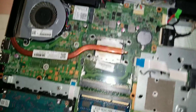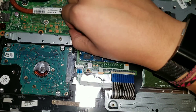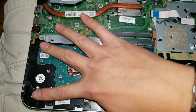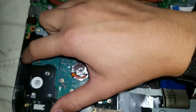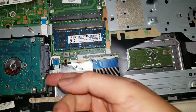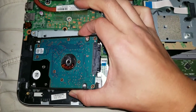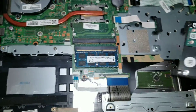Once you get that out, you can see the hard drive here. First thing you want to do is unlatch this cable so it won't get damaged. To remove the hard drive, there are two pieces that stick underneath these little plastic things. Once you get that out, you go towards the front and kind of just lift it up. Once you lift it up, this will disconnect and you just wiggle it out. These rubber pieces you need to transfer to the new hard drive.